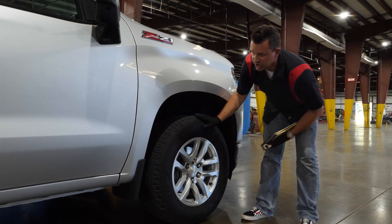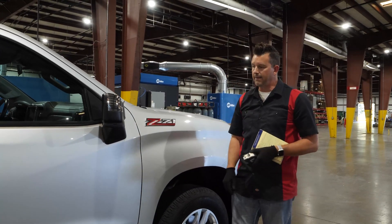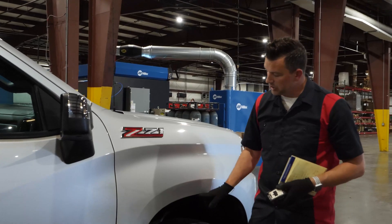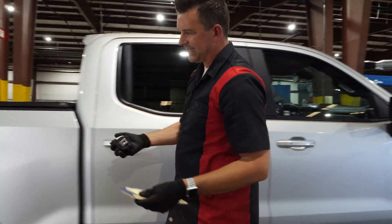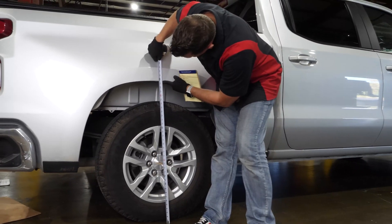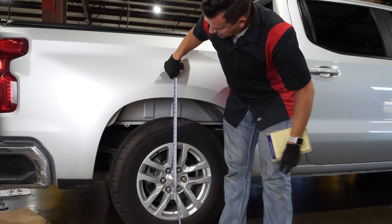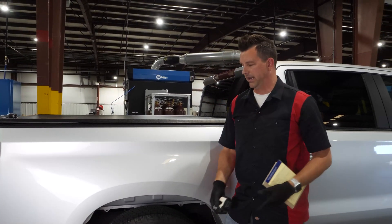On a half ton, we'll probably try to get it reloaded all the way — usually that's the case, but it varies. You can base that on feel, but we want to try to get this within about a half inch. The rear started at 38, and we're at 35 and 5/8 right now, so we've got some pretty decent squat, which we knew was going to happen because we've got some pretty decent tongue weight going on back here.